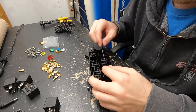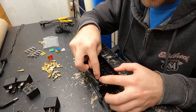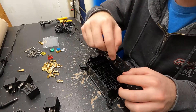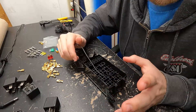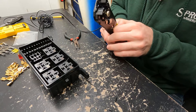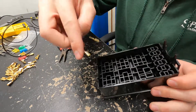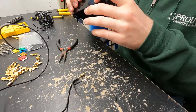All right, so I learned this technique from somebody else, so I'm not going to take credit for it. I'm not going to cut this and double splice a wire. I'm going to kind of loop it and get an idea of what size I need it to be. And then right in that spot, I'm going to strip out a section of the wire, fold it in half, and put it in this terminal and crimp it down so that the wire actually doesn't break — it just folds over itself and it's all still one wire. I don't know if that actually matters or not, but it makes sense that it might make a safer ground. So now I just need to jump to all the pin 86s.